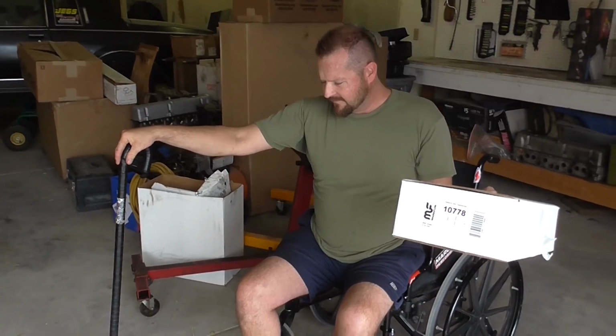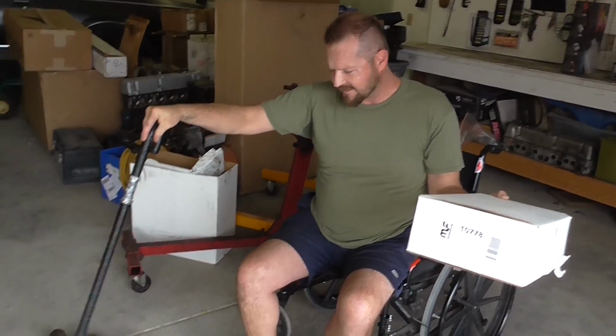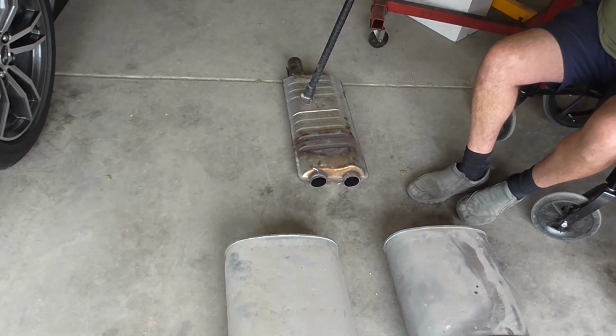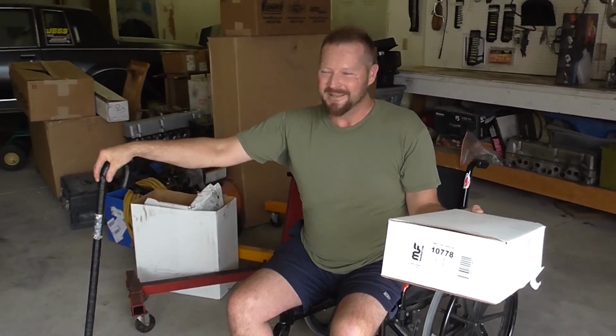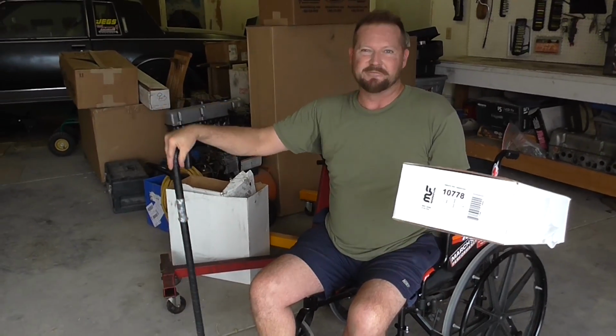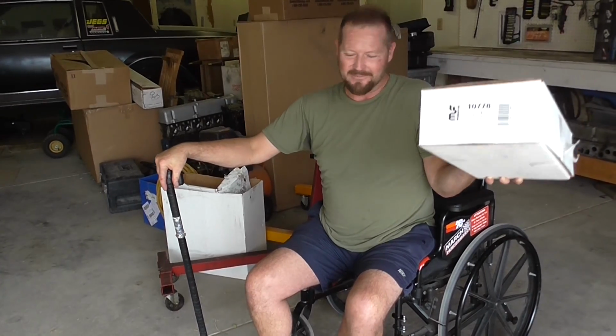And I have heard that Ford had a bulletin talking about resonators having heat spots in them. Well, I called them and they said it didn't apply to my Ford. However, when I looked at this hot spot and I looked at discoloration of the metal, it applies to my car. So I took it upon myself to fix it. My way, the budget boosting way, a Y-pipe.